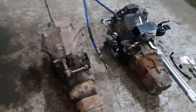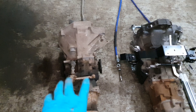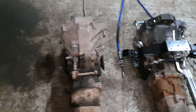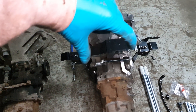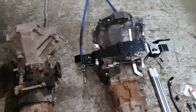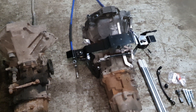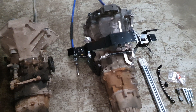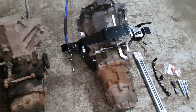One of the other main differences you should see straight away is the thickness of the body. The standard unit is actually quite a slender transaxle, while this one has much more thickness, especially around where the differential is. These are actually capable of taking up to at least 900 horsepower and 1200 Nm of torque, and that's with dumping the clutch and driving it as you wish.